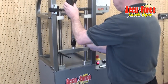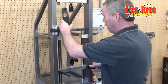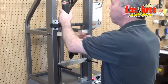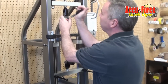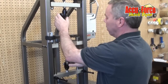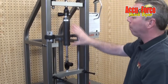Load the shock into the machine — it's got brass pins in here that float up and down. We've got a crossbar, and we set the height of the shock according to what it is. This is a gas shock, so it's going to have some pressure on it. At this point, we snug the two ends up so it's snug against the pins so there's no slop in the pins.